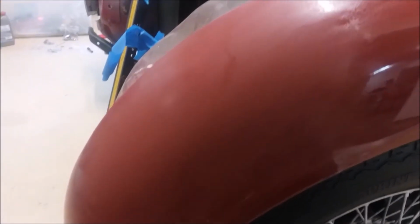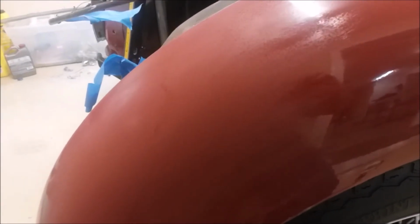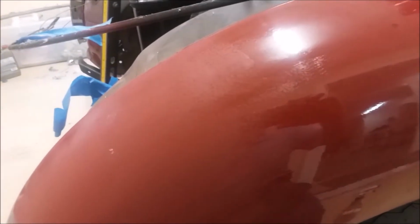Okay. I just got done with the 2500, all the way down to 2500, and I broadened the area of the 2500 coverage. I did most of it that way. Between each grit, I got out whatever scratches I knew the polishing compound wouldn't get out, or would take too much compound, based on my experience with the rest of the hood and playing with getting scratches out there. So I didn't make it perfect because the rest of the body has orange peel on it, and I didn't want to make this absolutely perfectly shiny, although I think it's going to be. I wanted it to blend in.